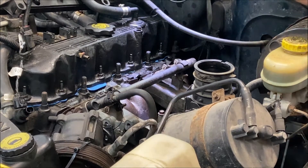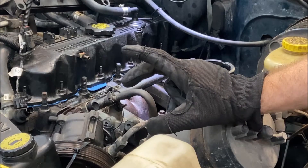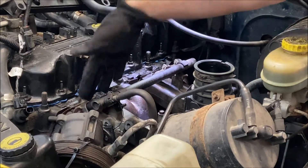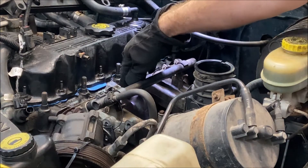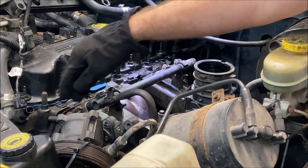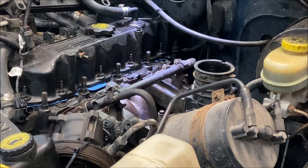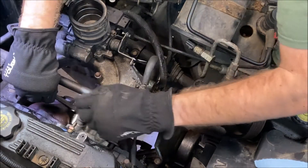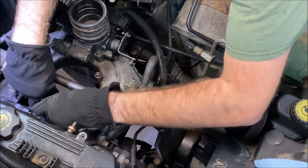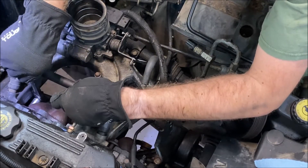You need to know the bolt numbering: one is at the top, two and three are on the sides, four, five, six, and seven follow. Order will be important especially when reinstalling. For now, remove all the bolts and loosen the nuts. Leave the center bolt if you have one, because that keeps the exhaust manifold in place — don't take the nuts off on that side or it'll let the exhaust manifold drop. So just the four bolts holding on the intake panel. None of these were really torqued down at all.